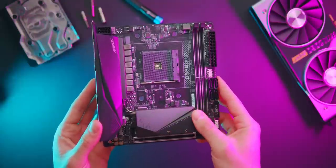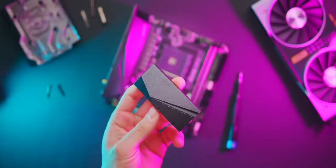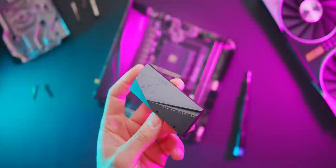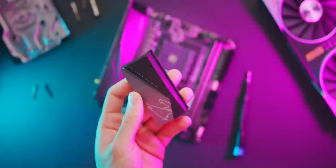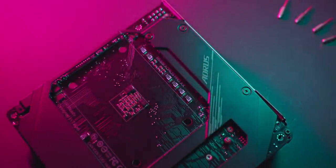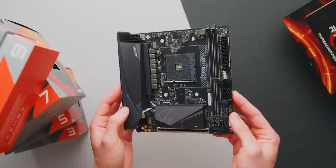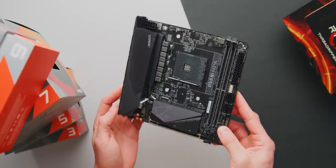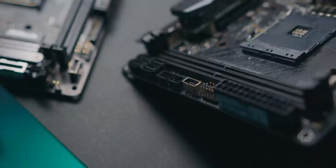As for the Gigabyte B550i Aorus Pro AX, it's the heaviest board of the four. As with their Z490 ITX board they've included a fairly pointless metal block that covers the M.2 heatsink and only really serves as a visual accessory — I'd prefer if it were actually part of the M.2 cooling design. That said, the Gigabyte board has the best passive VRM cooling design here: it's the only board with a heat pipe to dissipate heat elsewhere, and the cooling plate on the rear gets a big thumbs up. The power stages are sandwiched between heatsinks on either side, which is very effective. Unfortunately it's the only board of the four without a front USB Type-C header, which is a real shame if your ITX case offers that.